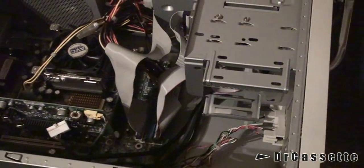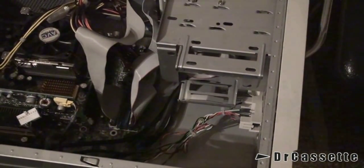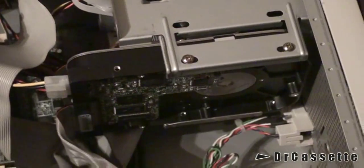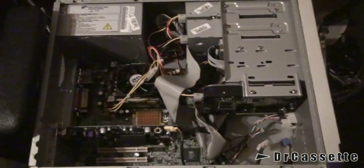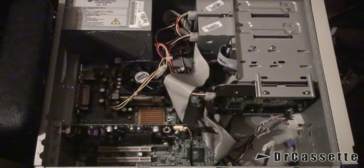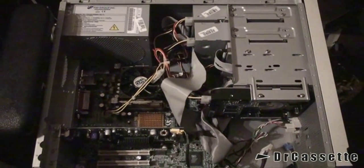A thing that's now missing is a hard disk drive, and then we're pretty much done. The computer is finished — I put in an 80 GB HDD. The only problem is it's a Chinese-made HDD, so I guess it's not going to be all too reliable. But I'm not planning on putting anything important on this computer, so that's okay. I blocked the open slot down there and organized those leftover front cables. Check the jumpers — they are all in the right places. Now let's go ahead and hook this computer up and see what it does.